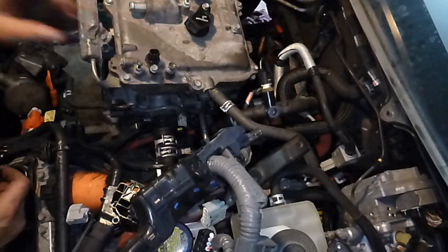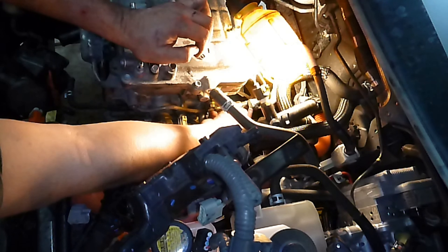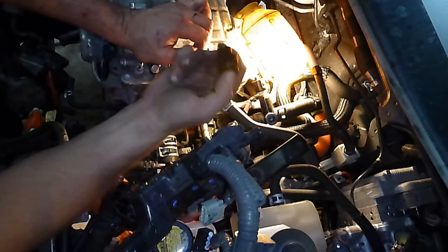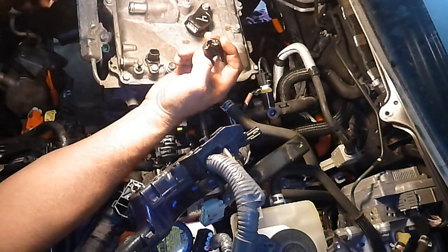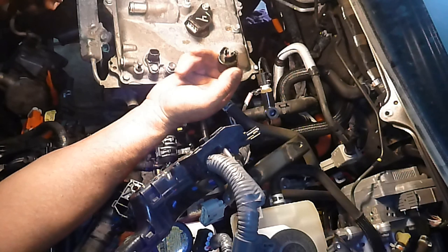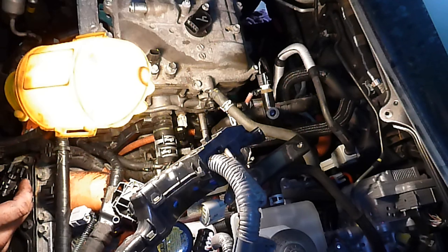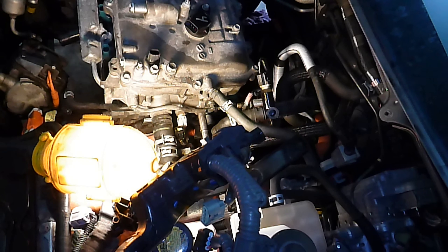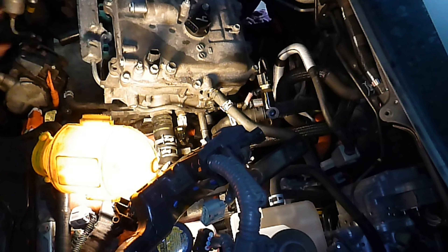Oh, I now have a clear shot at the fuel rail - I didn't know that was going to happen just yet. But here's the fuel rail right here. There's a little clip. You take the clip off. I wish they put a tool in the clip - wouldn't it be cool if they put the tool to get it apart in the clip? Anyway, so what we're going to do, we're going to disconnect, we're going to decouple that fuel line. Save this, save this, because this is the one you're going to want to use when you put it back together.